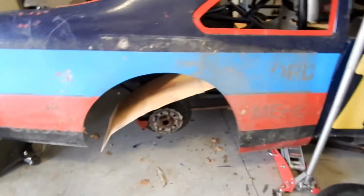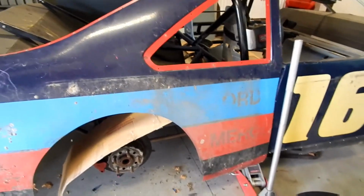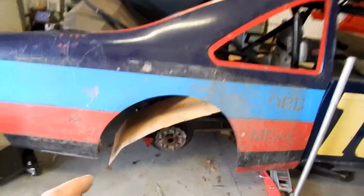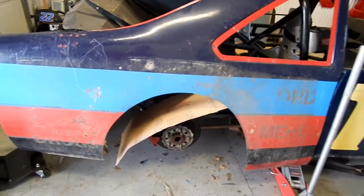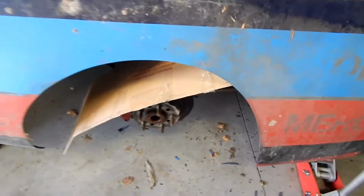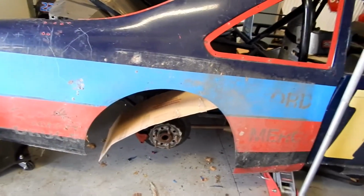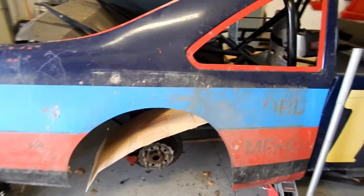Admittedly, I was going to just take this thing. I thought, the last couple times I've made something out of aluminum, I made it out of cardboard first. It works well. I cut it out of aluminum. It works great. Lately, things have been working out really great. I was going to just cut that big hunk of aluminum and thought, I'm going to cut that and it's going to be fine. I can picture it already. But I decided to stop and back up, make it out of cardboard first, and it's a good thing I did, because what I had planned is a little too wide. So I'm going to shrink this down by probably about a half inch, and then we will cut it out of aluminum, and then we can start bending it and see how it fits in there.